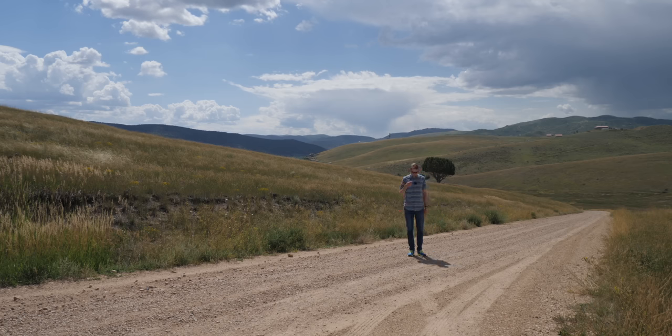Now, how far can you transmit with these? RODE says up to 260 meters. Here's my experience. With 2.4 gigahertz, it does pretty well indoors if you don't have a ton of other Wi-Fi around. And that's going to be most environments. It's not going to be a huge problem. Even in office environments, I haven't generally found it to be a problem. It is potentially a problem, like I said, if you go somewhere where there's a ton of Wi-Fi activity, where there's a lot of people, tons of people, convention show floors, stadiums for concerts or sporting events. That's where it's going to struggle a little bit. So just keep that in mind.